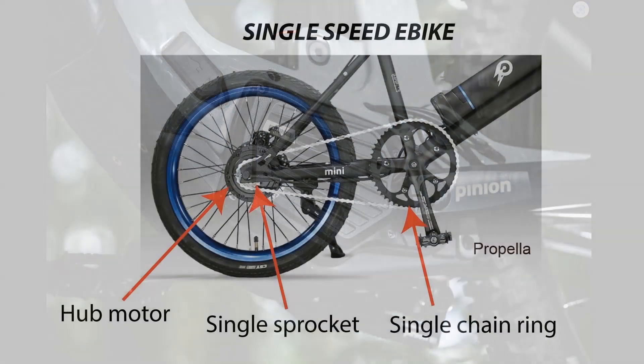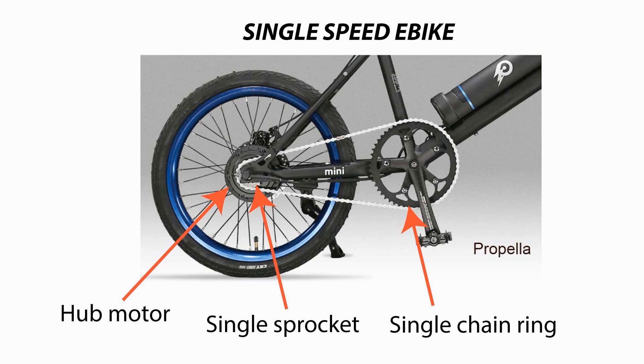For those who don't have that much money and prefer the simplicity of not having to constantly change gears, there is the single-speed e-bike, which is much less expensive than a geared hub system. This requires a hub motor, because mid-drive motors don't work without a choice of gears on their rear wheel. A single-speed e-bike can work with either a front or a rear motor. On these bikes, there is only one sprocket on the rear wheel and a chainring on the pedal crankset. If you're interested in this option, you might want to watch my video 'I Hate Changing Gears,' linked in the description.